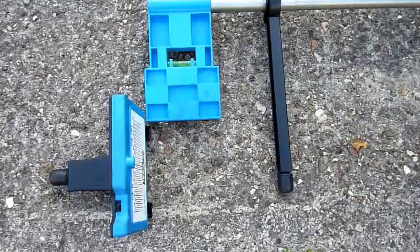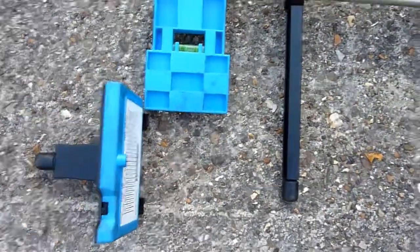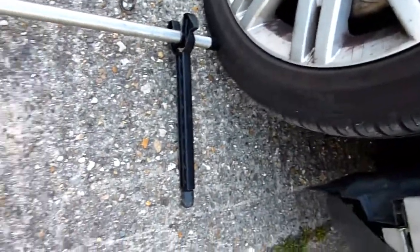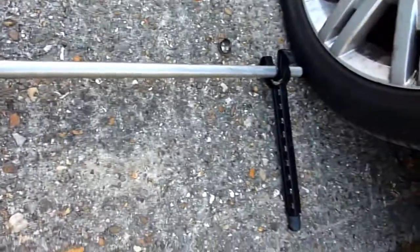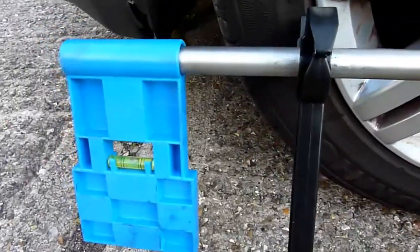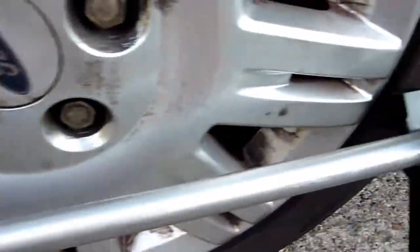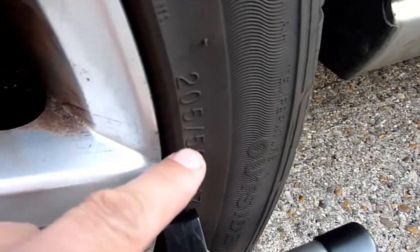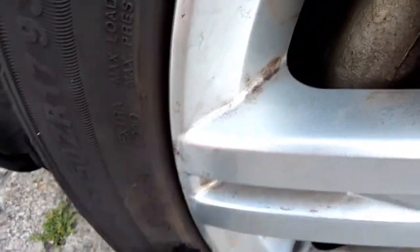Got my track pace. I'm going to do some tracking. Roughly getting the correct distance of this laser from the offside tyre. We're using this to measure. Next set up — make sure this is level, as level on the near side. I'm using the rim of the tyre because it's impossible to set it on the metal rim.